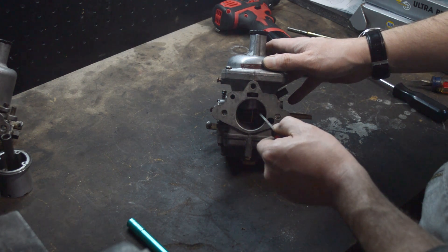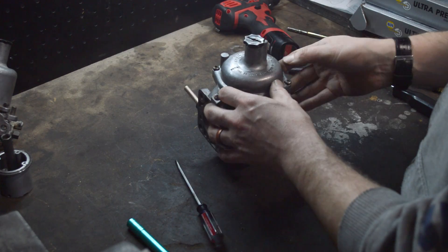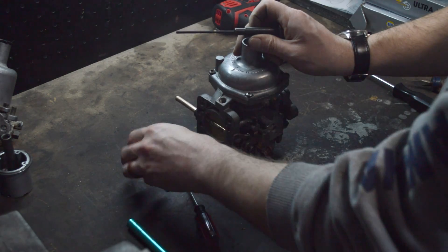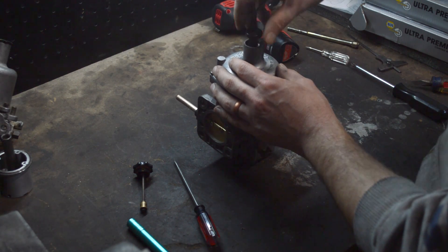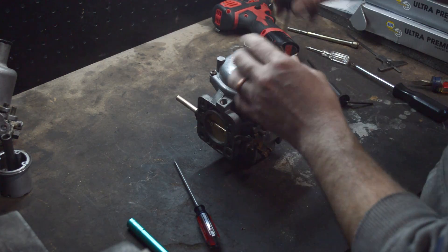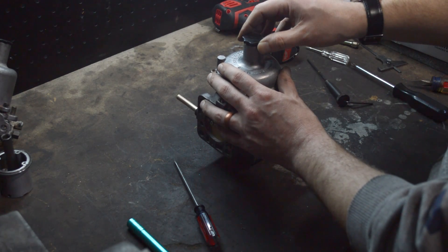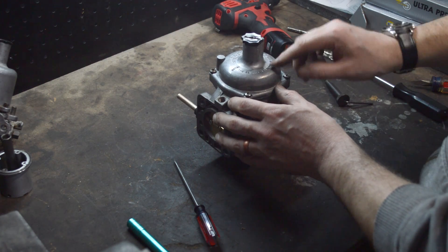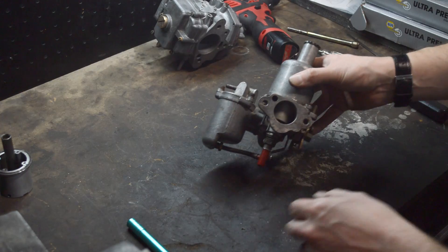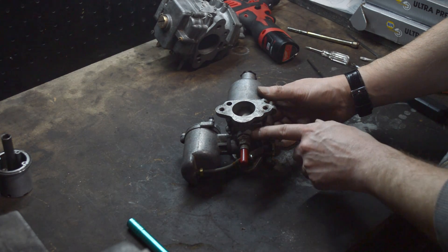That's going to raise the air piston — actually it's going to raise it slowly, but it's going to raise the air piston. That's going to keep the mixture ideal for the engine's operating conditions. You affect that mixture by using this tool. In a Stromberg you can turn this to raise the needle or lower it. We talked about the oil inside the dashpot — that's going to dampen the movement of the air piston going up so you get a temporary richer mixture. On some Strombergs there's an adjustable jet on the bottom, not unlike an SU carb, where instead of moving the needle up and down you are raising and lowering the jet.